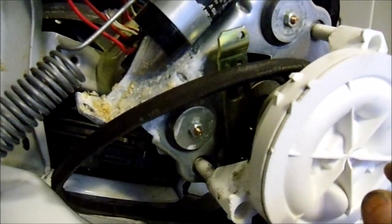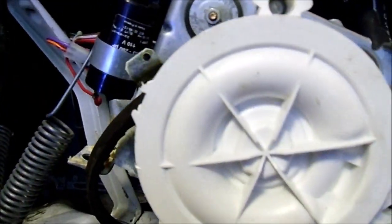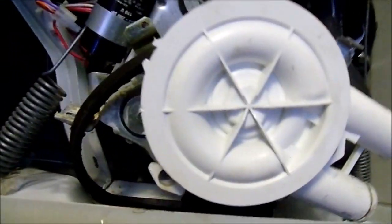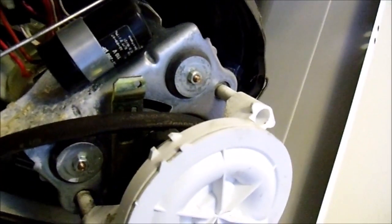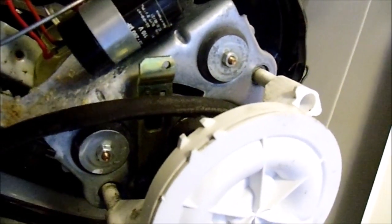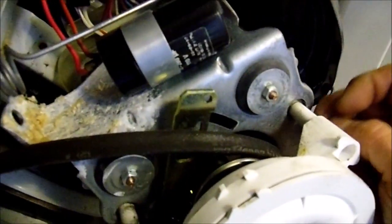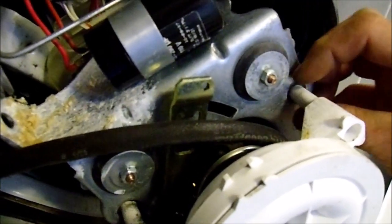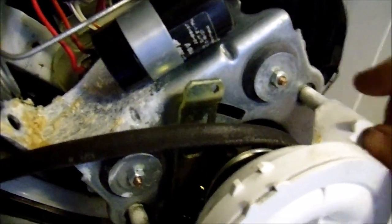You're going to have to take the belt off the main pulley back there — be careful with the hoses and the sharp metal. Here's how you access this pump: basically there are these three Torx screws. Pull those out and it should come out; if it doesn't, it could be rusted onto the motor shaft and you'll have to bust it off. If you're just installing a belt, you don't necessarily have to take this off — you can cut one of the shims with a hacksaw, put the belt through, then put the cut piece back when you mount it.